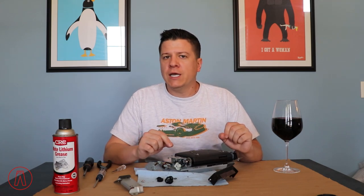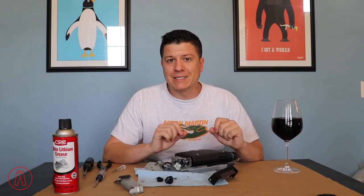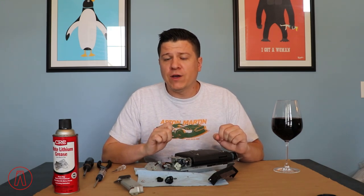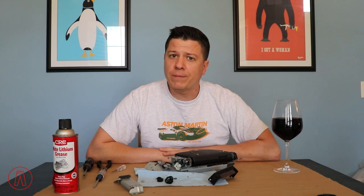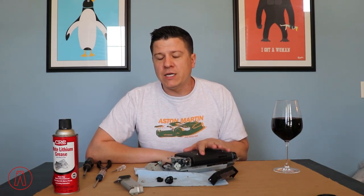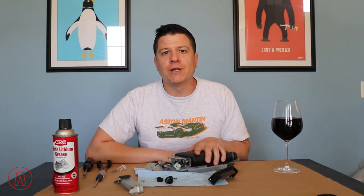Make sure those gears are lubed up and then reassemble everything. Test this out in the car to make sure it works — and it should. If not, you may have a bigger problem with the screen unit itself, and those can be pretty expensive. That's all for this video. If you have any questions, please feel free to reach out at rich@redpants.lol or the contact page at redpants.lol, and make sure you browse those DIY guides. I have a very detailed step-by-step instruction guide for this one with pictures that's probably even easier than watching this video. I hope that helps and I will see you next time.